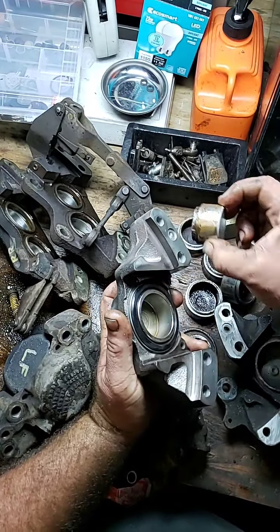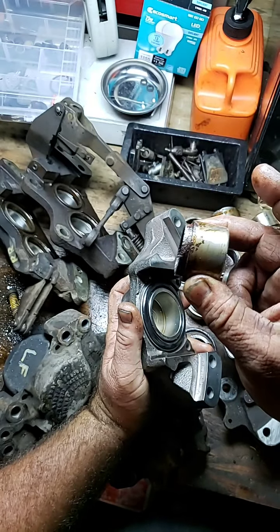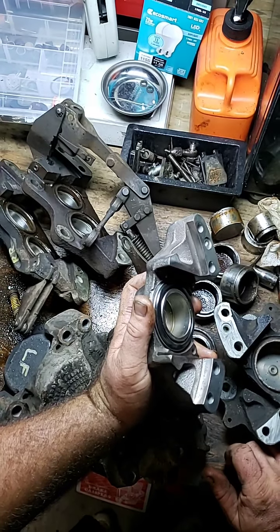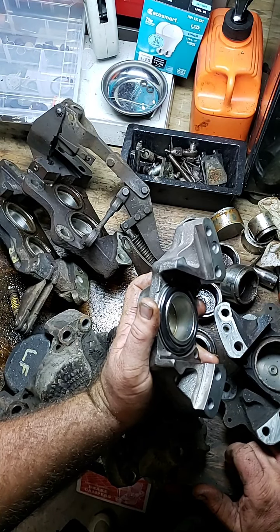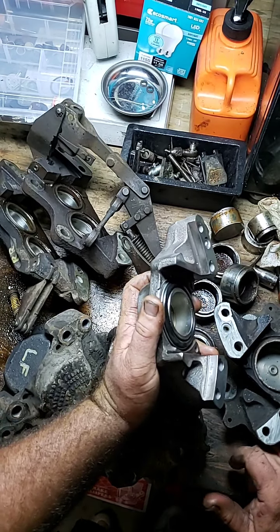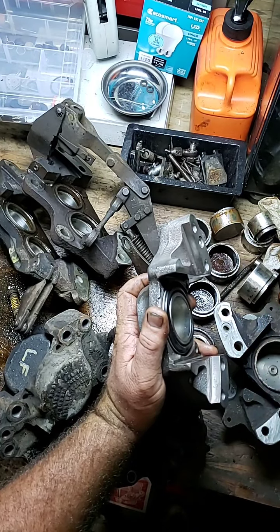It's a real shame — why would you even shove that back down in there? You're going to get the caliper seized. I had another guy call me today and he said, I just watched your video and my mechanic — the caliper's freezing up, it's burning up on the back wheel. I said, did he rebuild it? He said yes. I said, well, if it's burning up the back wheel, if smoke's pouring out, obviously he has a piston that's seized in there. The seizing is going up against your rotor — it's catching fire and you're going to end up burning your car down.